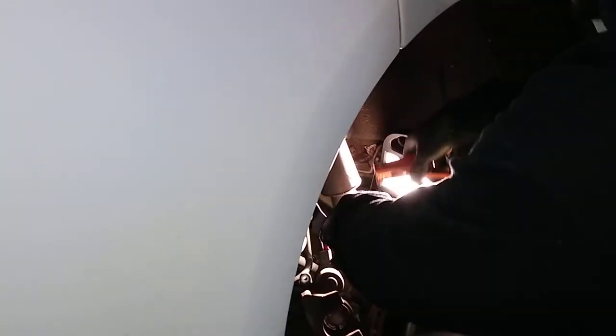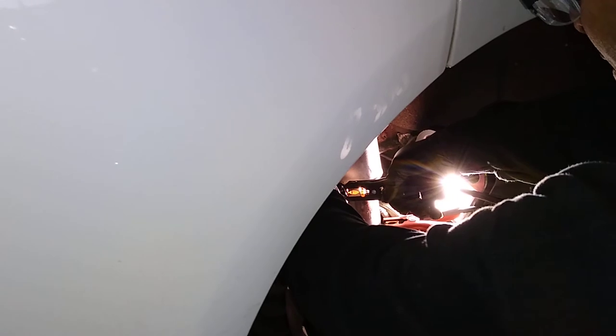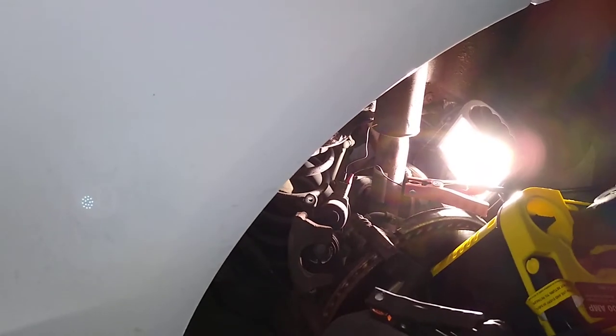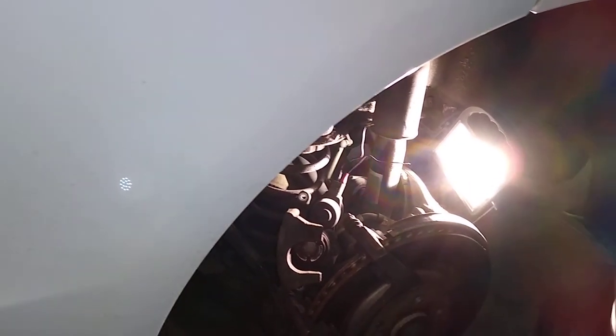As you can see, it's almost there. I believe this will be my last wind out. Just be careful with whatever 12-volt source that you're using — you don't touch the leads together, that's sort of shorted out. I'm using my jump box. All right, so that was the sound. As soon as you hear that sound, get off of it, because it'll try to twist that piston back in.